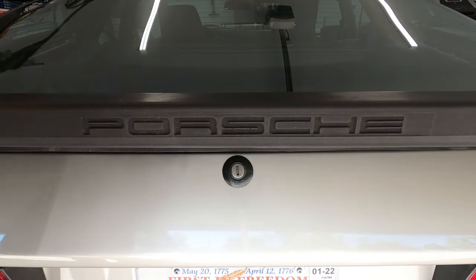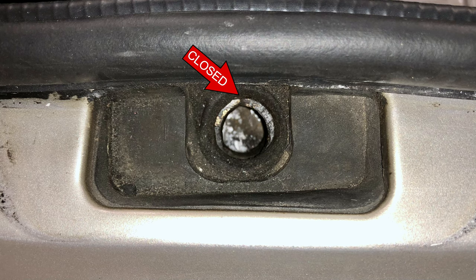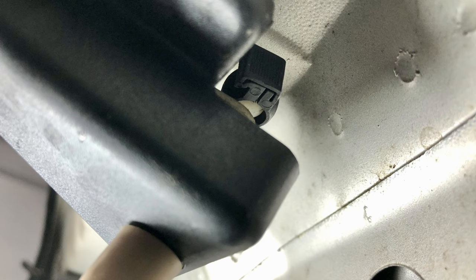If you're experiencing an issue with the hatch only locking on one side, there are a few things that you'll want to inspect, and one of those is the locking arms. With the locking mechanism released, confirm that the arms inside each pin receiver are in a fully closed position. If one of them is partially open, you'll need to disconnect the ball joint below the receiver and loosen the plastic ball socket on its connecting rod, thereby extending the overall length of the rod. Before removing the ball socket, make sure to open the locking clip on the end of that fitting so that the socket isn't damaged during the process.